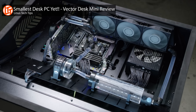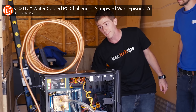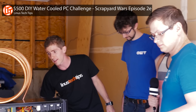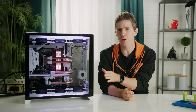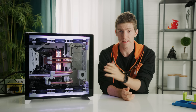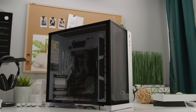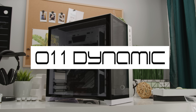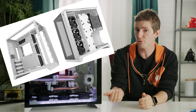So the first question is why? Why would we do something like this? I mean, it's good to try new things, but aside from that, is there any reason to use metal tubing, copper or otherwise? Truthfully, other than looks, no. So if you're only worried about cooling performance, it's probably best to stay with inexpensive soft plastic tubing, because even a massive coil of copper tubing doesn't dissipate much heat. So the relatively small runs in your case won't make a measurable difference.